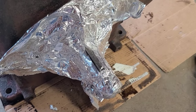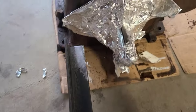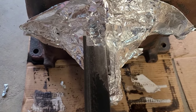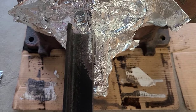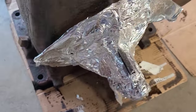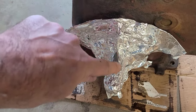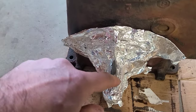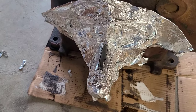Here's the plan. I've got my tinfoil in place. I've got a nice piece of angle iron here — I cleaned it off really well. I cleaned off the top of the Woodruff Key. I'm going to go ahead and get the MIG welder and just weld this piece of angle iron to the top of the Woodruff Key. Hopefully I'll be able to pry it out. As you can see, the tinfoil is in place just to protect the crank. Obviously this is the only side I really need to worry about — I really don't care if something splatters up on the block. Let's go ahead and see what happens.